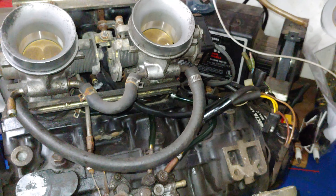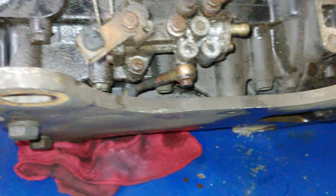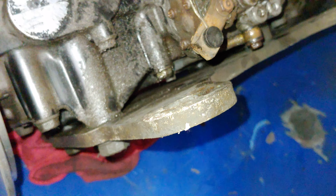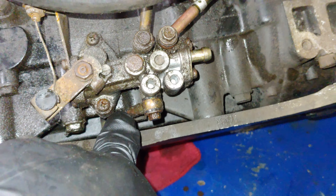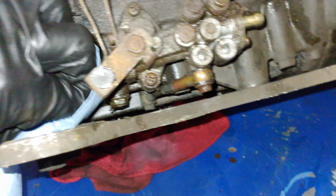Here's the 96 580 EFI — just pulled it out of the sled. It's definitely leaky right here, assuming maybe a gasket around the oil pump. There's also this guy under here which doesn't look like it even has any type of clip on it. This thing's just loaded.